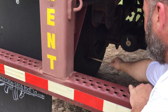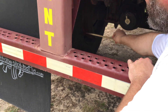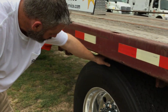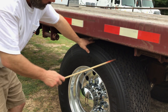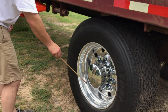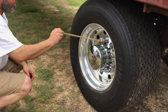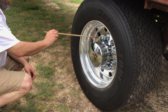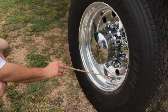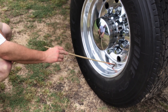My inner wheel is properly mounted and secured. It's not cracked, bent, or broken, and it's free from illegal welds. My inner tire wall has no abrasions, bulges, or cuts — it's properly seated to my inner wheel. My tire has more than 2/32nds of an inch tread depth — to check the tread depth I would use a tire tread depth gauge. It has no abrasions, bulges, or cuts. My outer tire wall has no abrasions, bulges, or cuts, and is properly seated to my wheel. My wheel is not cracked, bent, or broken — it's free from illegal welds, properly mounted and secured. All lug nuts are present and tight, not cracked, bent, or broken. Signs of looseness would be shiny metal or rust trails. My valve stem is properly mounted and secured. All nuts and bolts are present and tight. It's not cracked, bent, or broken, and since it holds back air, it's not leaking. This tire has 100 psi of air pressure — to check the tire pressure I'd use a tire pressure gauge.